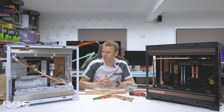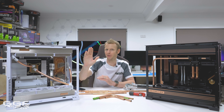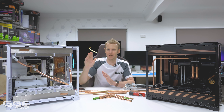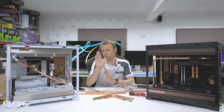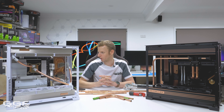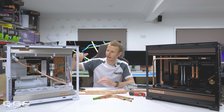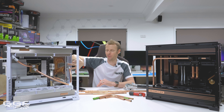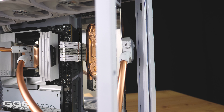So you get a little bit more. But if you do run your GPU in the forwardmost slot - moving it more towards the main section - it will have an issue running the riser cable into the cable grommet, because the cable grommet is perfectly in line with the GPU in its back slot. So moving it forward, you really need to put a bend on that riser cable. Also something to take note of: running the fittings in the back if you do have a very wide card, say up to the 160, you may have to run both your in and your out from the front, because running it in the back, it will bulk out the frame and cover those ports.